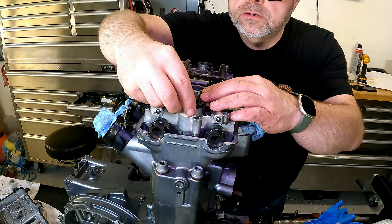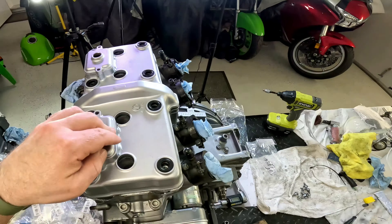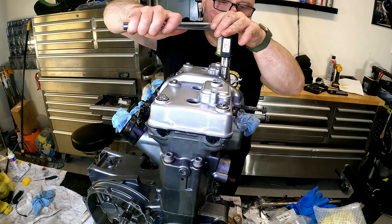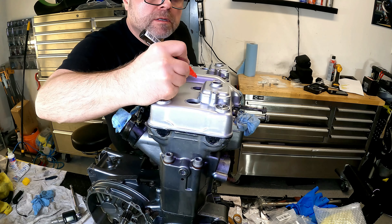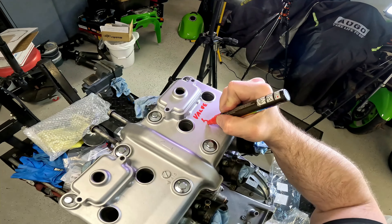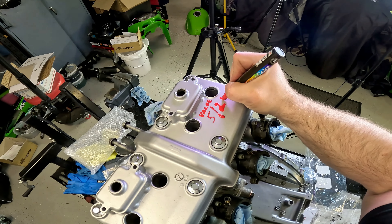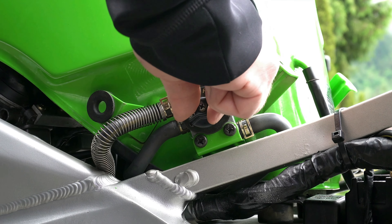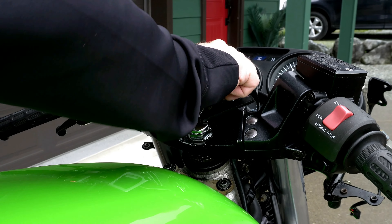The valve cover can now be reinstalled after new seals at the spark plugs and a new cover gasket. Be sure to apply clear silicone seal in the crescent sections of the valve cover — black RTV silicone will also work in a pinch. Both the cover and gaskets only go on the engine in one direction so be sure to confirm you have everything aligned before getting carried away with that silicone. Valve cover back in place, I use new bolt seals and torque them down to the specified 9.8 Nm working from the center of the engine moving outwards. The top of the engine is now sealed up and the spark plugs can go back in. One final touch — after all this work I leave a note for a future owner indicating when the valves were shimmed last. With the shims done, I can get the rest of the engine back together and installed back in the frame. Check out the next video to see if it all worked, and until next time, be sure to ride safe.